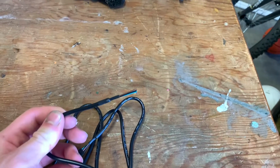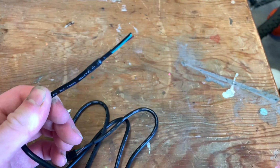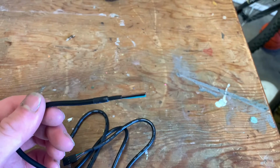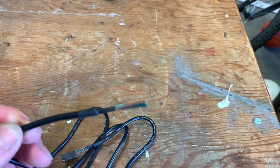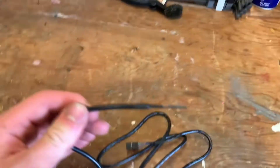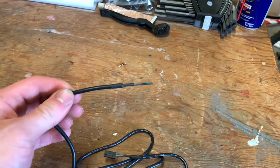So you've got 3 wires coming out the back of the harness here. You've got black, which is the engine ground, green, which is the narrowband. I'm not going to use either of those because I don't really need to. What I'm worried about is the brown, which is the wideband. I'm going to be connecting the wideband wire to pin number 75 on my ECU. It depends on what year the car is and things. It's probably going to be different for yours.